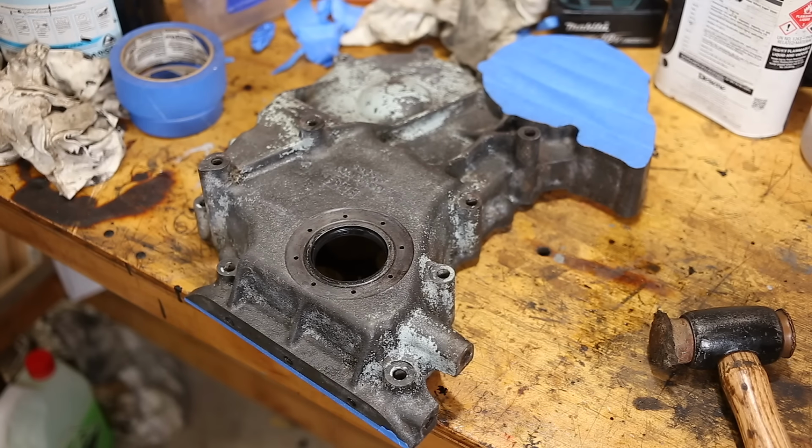This is a new paint system to me. It is thick. Crazy thick. I've never seen paint this thick before. And Real Time Me said, I wonder if it'll spray through my small gun. We still have to add reducer, of course, so we'll see. This is a 2K system, so it uses a hardener that contains isocyanates. 2K paint is just generally better, but you can of course use a normal industrial enamel if you prefer. That's all I used on this motor, PPG 2.25 quick dry to be specific.